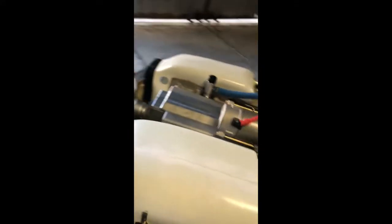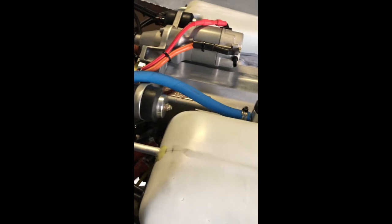I think I've pretty adequately covered the work involved in that. First 25 hours we're going to run the run-in oil — Aeroshell 100 I think it is. Nice new chrome exhaust. One thing with the exhaust pipe — I didn't receive the heat exchanger that gives you the hot air up to your carby. So when you open up carby heat, that takes the hot air off your nice shiny new chrome muffler. I had to use the old heat exchanger, which wasn't supplied with the engine. So it gets back to where the engine starts and stops — it stops at the muffler, I didn't get that.